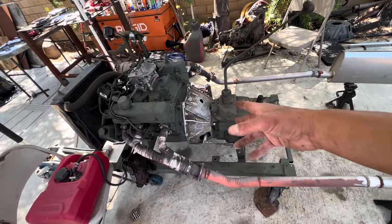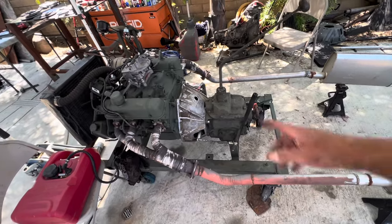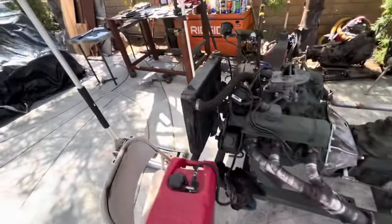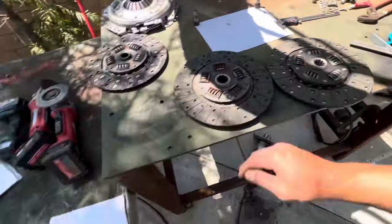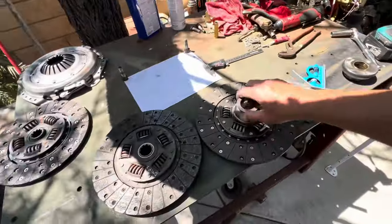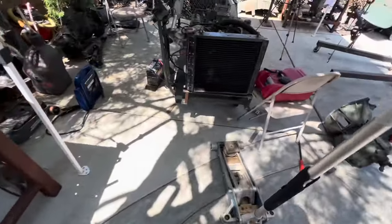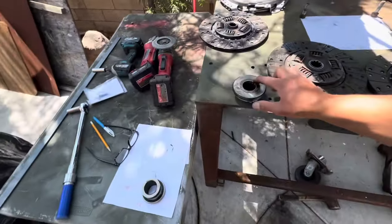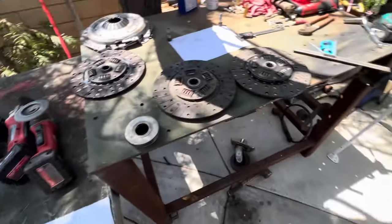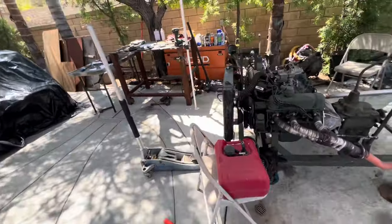Final recipe: 20-25 foot-pounds pressure on the clutch plate. Your disc — you need to grind down the front hub in order for the 1-5/8 bearing to work, or for the Novak to work. And if you do use the Novak: 1-5/8 clearance on the outer edge. That's pretty much it. I'm worn out.